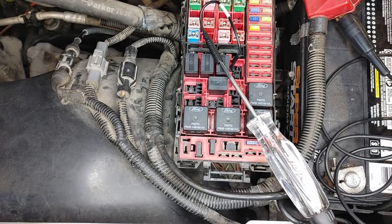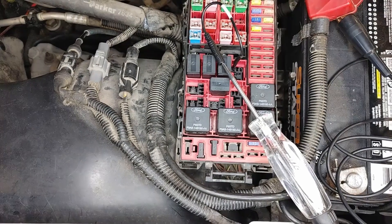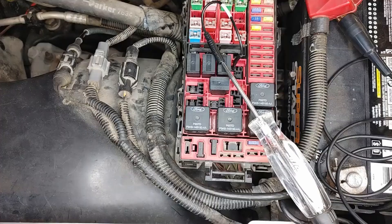So I'm going to hit the horn button, and if that lights up, that means the ground side is working, because the ground for the relay goes to the horn switch. So I'm hitting the horn button right now. You guys can see it's actually honking — or controlling it. So everything works the way it should. That kind of leaves your ground, your relay.